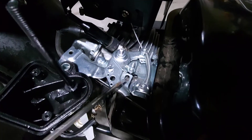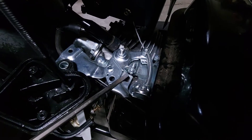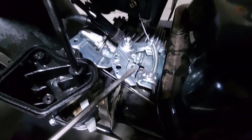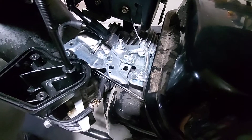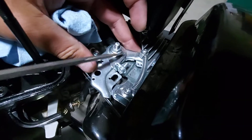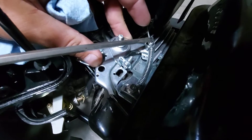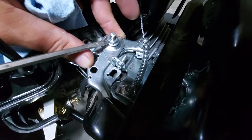On all of these that I've seen, this screw right here is welded — you can even see there's a little dab of weld. People sometimes say you can drill it out, cut it out, do whatever you want. I'm all about making it cheap and easy. This little arm right here is what you're getting at — it goes from here to here, almost like a little C-shape. First thing you do: remove that screw, remove this nut.